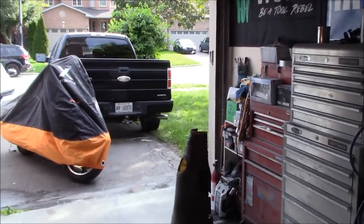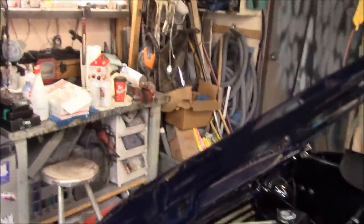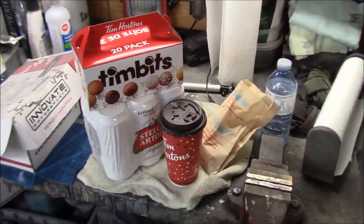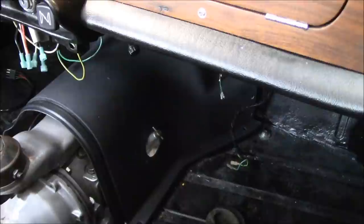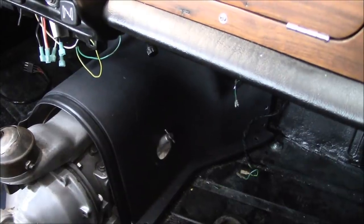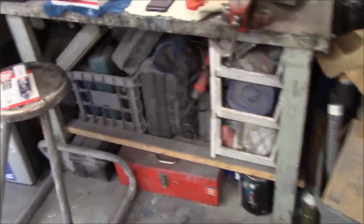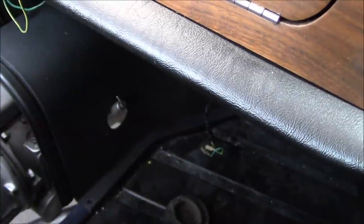Saturday the 25th of September, just coming up to 10 a.m. Final wiring day on the '68 Triumph TR250 today. We've got Alin stopping by to give us a hand — I've got his workbench set up with his essentials over here. As you can see, I did drill a hole in the front cover, but unfortunately I didn't drill it very well. I drilled it based on the other cover's location but should have done a better job measuring out this new cover. So I'm going to relocate that hole. I've kept the plastic plug I pulled out of there and I've got some plastic bonder. We're going to put the plug back in and re-drill a hole a little more carefully and a little smaller to get a smaller grommet in there just around the neck of the filler.